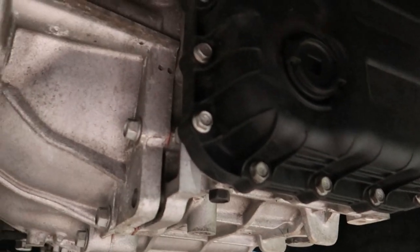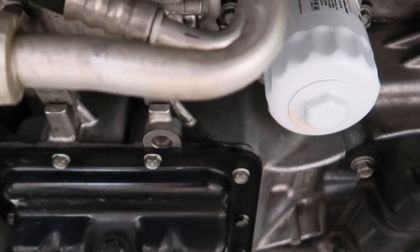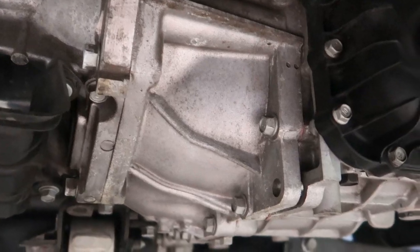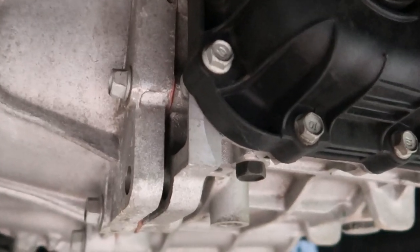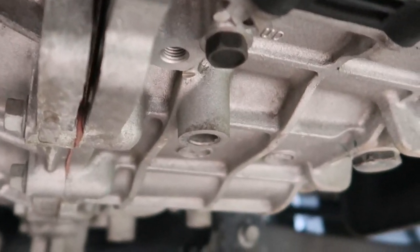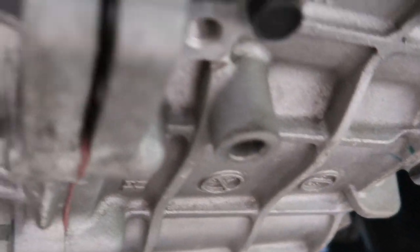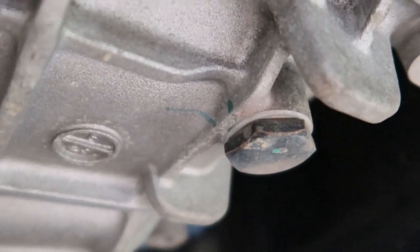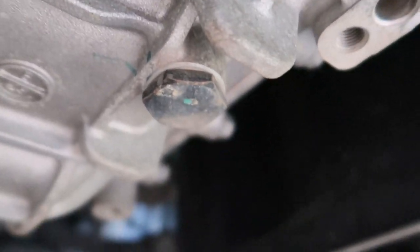The transmission is underneath the driver's side right here. Here is your oil pan for reference and your oil filter, and right over here — at first I thought it might be this black bolt right here, but that is not it. It's right behind there, and it's a 15/16ths or a 24mm socket — either one will remove this drain plug. There's plenty of room down here to work around so we can get our drain pan underneath. This doesn't have a lot of torque to it so it breaks free pretty easily.